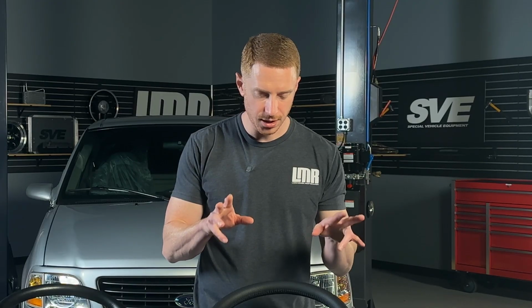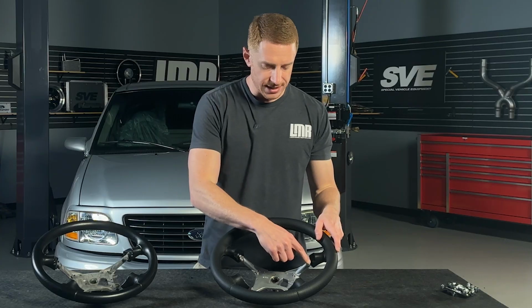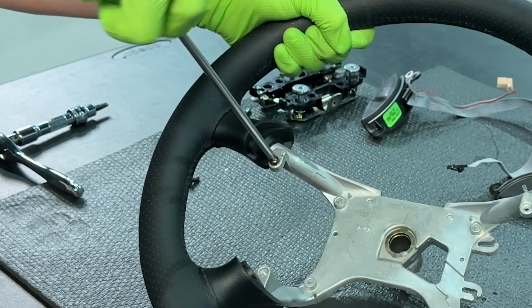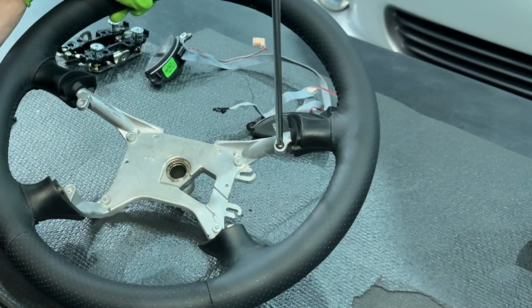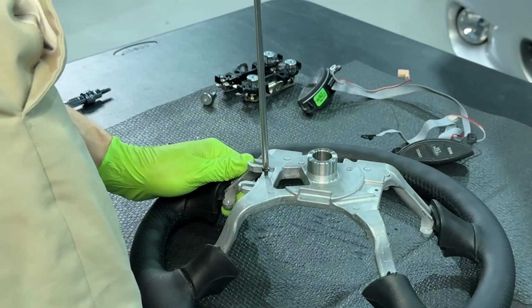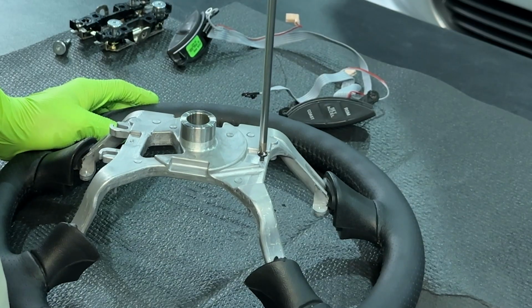Speaking of the cruise control switches and the rearward trim, the attaching locations, you'll have to cut threads. You'll have to use your factory screw to cut threads into the aluminum, and when you do this, don't go at this with an impact. Use your hand tools and work in a methodical manner. We'll show that here in just a second whenever we install one into my truck.